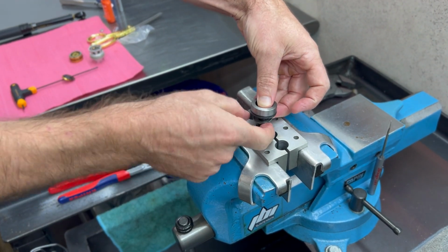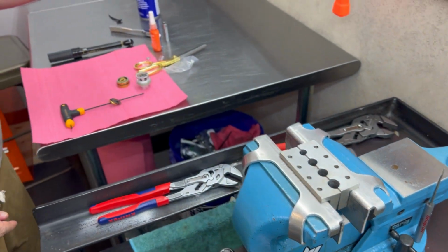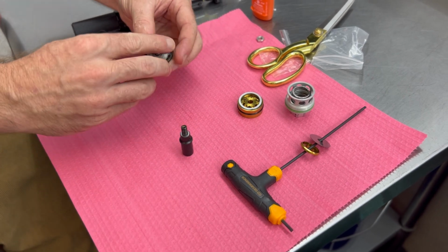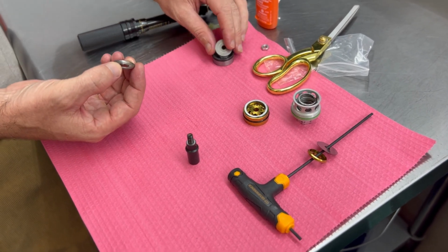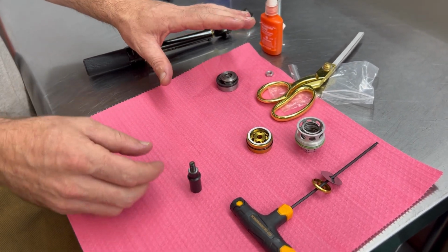and kind of hold on to it because it can fall apart now that the nut's gone. And we'll lay that right here. This is the main piece we want. Everything here in terms of the piston, all of the valving that's there can stay, and the high-speed adjuster plate can stay. We're not going to utilize any of that.